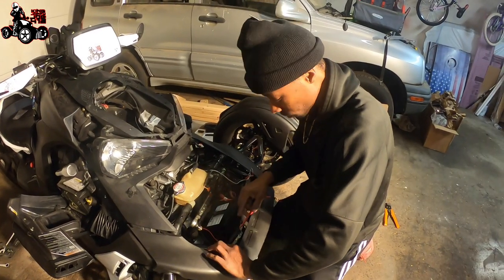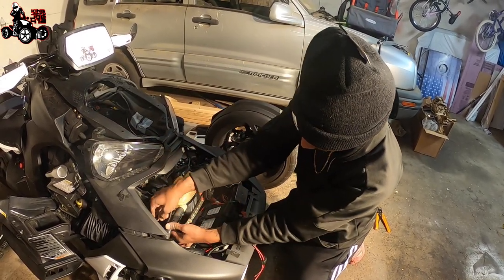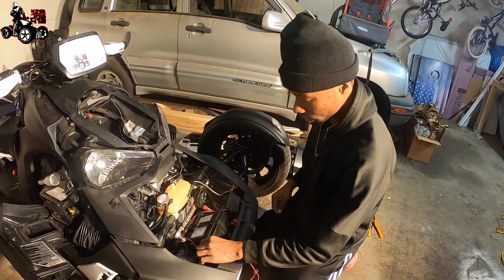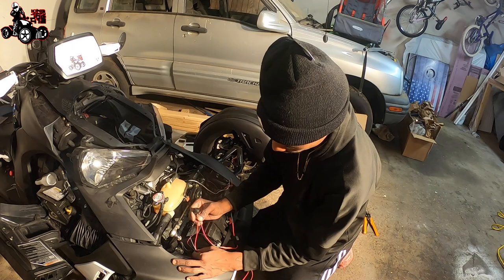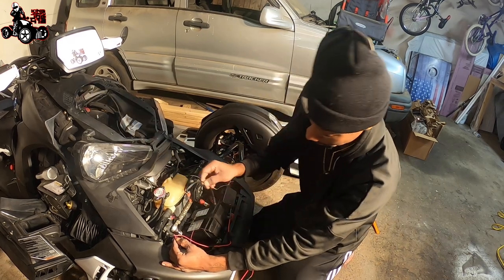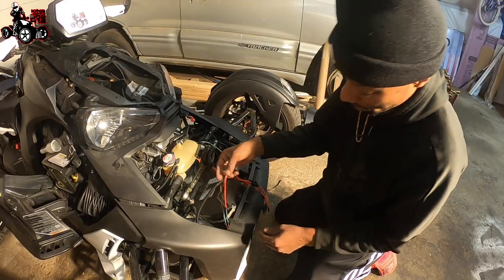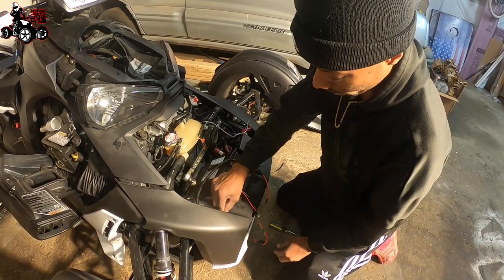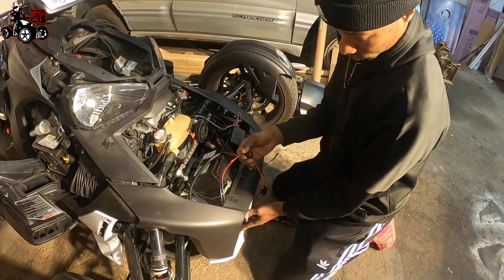Positive negative. I ran it down this side of the bike. I'm going to hook it to the positive negative. What I want to do is, if I'm connecting it to the grill, which I'm going to be connecting it to, I have my negative and my positive from my grill. I'm going to cut them from this wire and then I'm going to splice them to this plug here, which I can plug it to here. I'll be cutting my positive and negative wires - the switch and fuse that came with my Top Notch Riker grill.